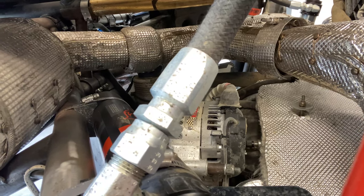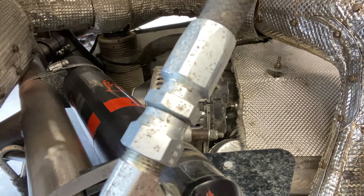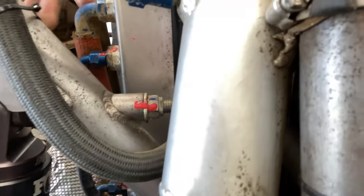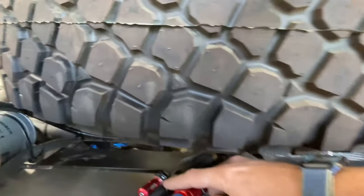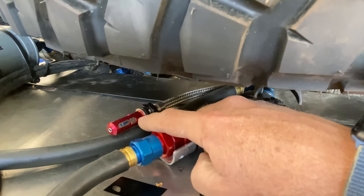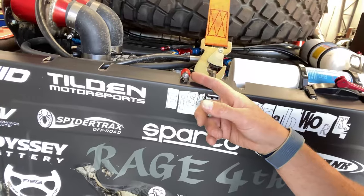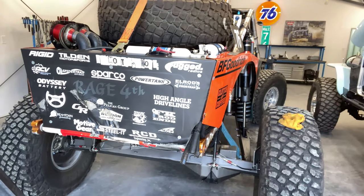It's got Power Steering Solutions — Charlie makes the best power steering stuff — with his reservoir back there. A race-proven alternator. Huge Fox 3.5s back here. There's another CNR transmission cooler back here, and the radiator has a built-in oil cooler and built-in transmission cooler inside it. On the safety side, there's one of our automatic SafeCraft systems back there, and there's another one right here that's a glass-break type. If this thing catches on fire and the temperature gets up to around 240 degrees, this one will blow and put the fire out — sometimes putting the fire out before you even know it. And this little guy here is my secret weapon — my backup camera, which is actually on all the time.